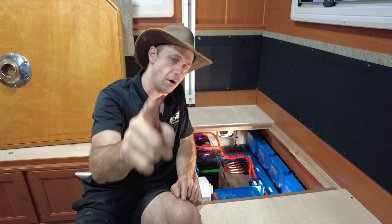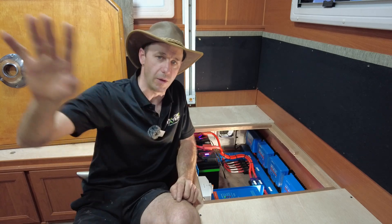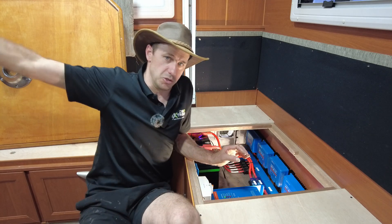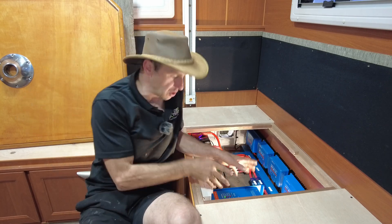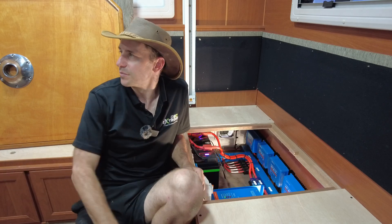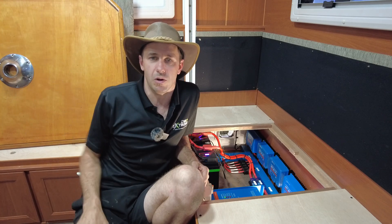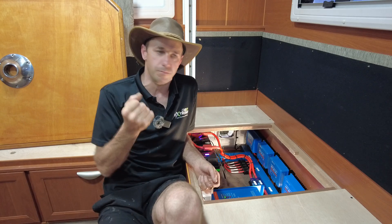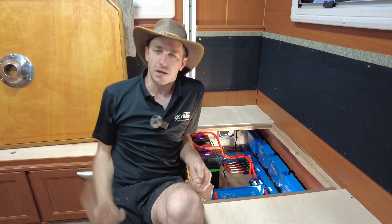This has a Suburban hot water service. The Suburban hot water service has a massive 240V element — that's on AC2 on this, nothing to do with the inverter. This inverter has no potential to run that hot water. If he leaves that hot water switch on and turns the inverter on when free camping, the hot water won't come on. He'll put it on gas as you do when free camping. It's like 1,800 watts — maybe even 2,000W — and if it did run from the inverter, you'd see 2,000 watts on the touchscreen and it won't last long.